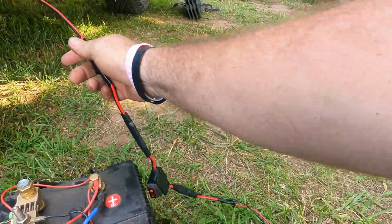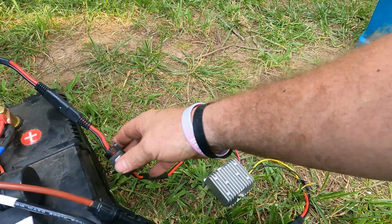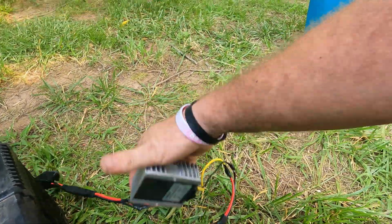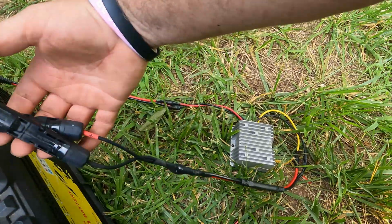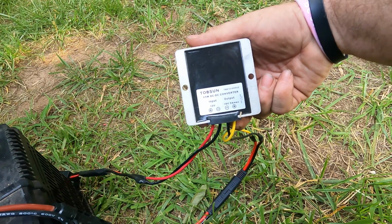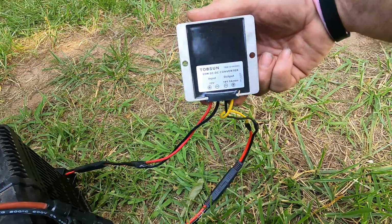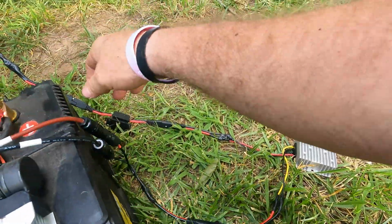We've got our battery wire coming in, got an on-off switch, we got fuses out the wazoo that way. We have this inverter thingy, converter thingy, and I went into the... we got this converter thingy that is a 95 watts DC to DC converter, input 12 volts, output 19 volts. So it's kicking up 12 to 19, and I put it into the solar.